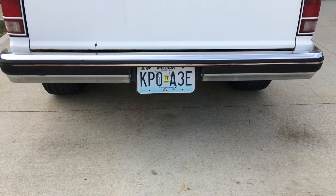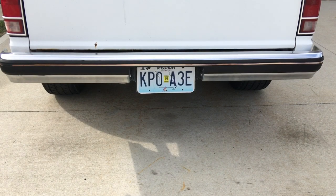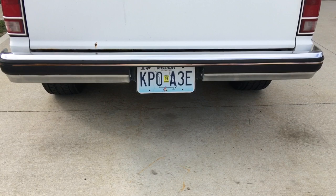This is my current idle at just around 800 RPM with the Elgin 1838P — or Sloppy Stage One cam — in the 9.7-to-one compression 4.8 with ported heads and bigger intake. Sounds pretty good, drives good, doesn't try to die or anything. At least I finally got something good to make a video about. Please like, subscribe, and share — hit that little bell, hit up the comments whether you like it or not. Appreciate you guys watching.